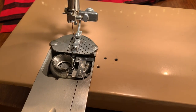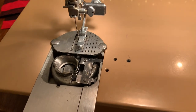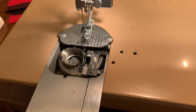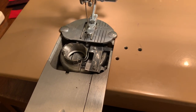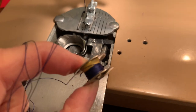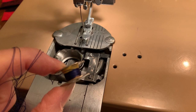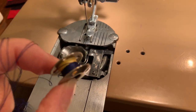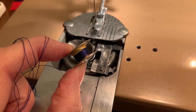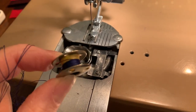I'm getting ready to sew my first project, and I always recommend double-checking the bobbin thread spool — don't ever trust it. Thread could be old, saturated, or just not in good quality after maybe living there for 40 to 70 years. This one in my machine actually had three different colors of thread wound on it. So definitely just unwind your bobbin and start fresh.